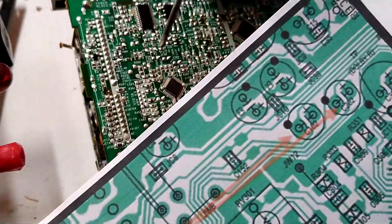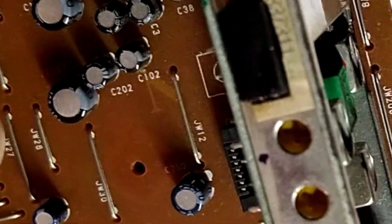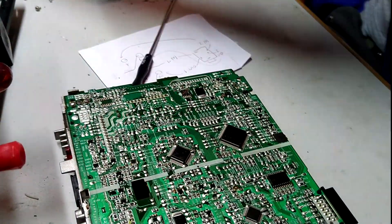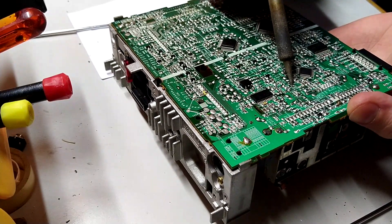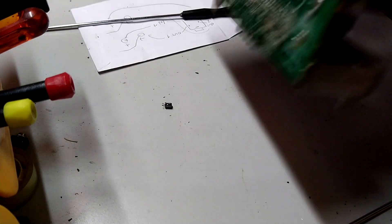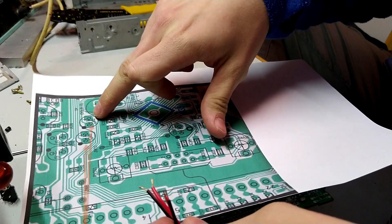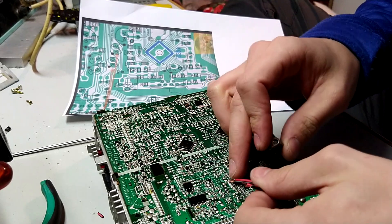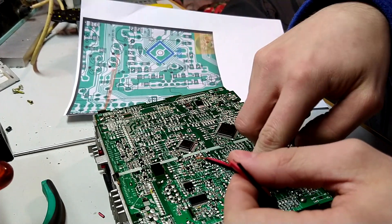These two are the ones. This is what I'll be soldering into — trying to get this to work. In here you can see C102 and C202. These two capacitors have to come out, and this is where I wire in the auxiliary input. Red comes in here, goes to the switch, and then the black one goes from the switch into the other capacitor point.